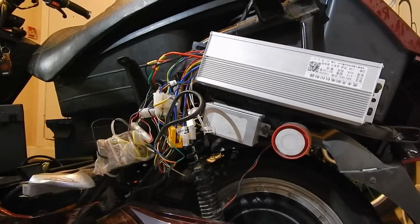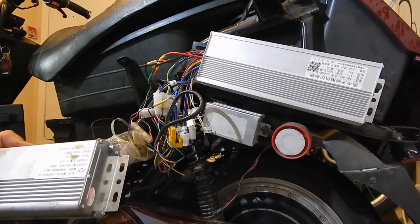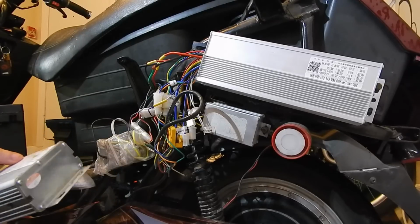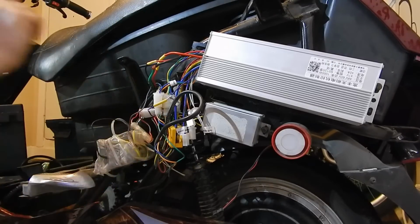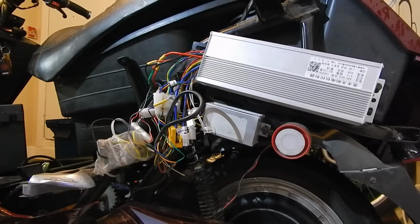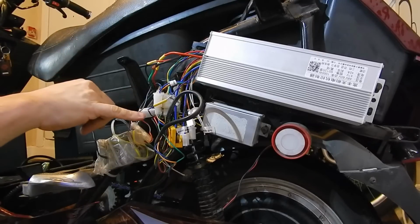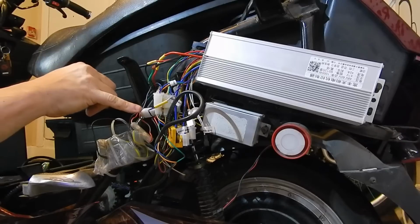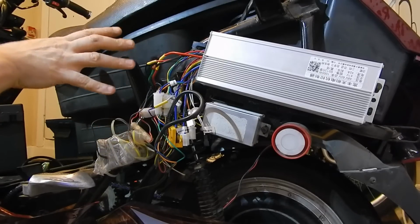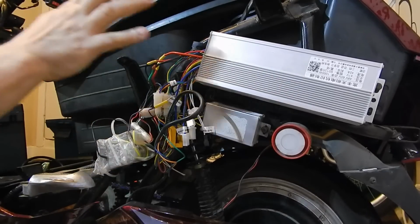Okay, there's one thing I wanted to post. Your old controller had what you would call regenerative braking, where, remember you said you would let off on the throttle and then it would brake. They call it brake high level. But on this one, it doesn't work like that. It doesn't have regenerative. What it has is high brake, but how it works is there's a switch on each one of the brake levers. So if you're flying along and you have to panic stop, most people forget to let off on the throttle, so you're fighting with the throttle as you're braking. What this extra purple wire that was on the throttle plug does is it's for your high level brake, and as soon as you pull the brake in, it cuts the motor. But there's not going to be a regenerative, and you pay a lot more than 20 bucks for a regenerative controller. So just so you know, it's not going to be the same, but every function on this controller does work.